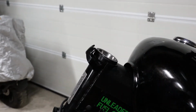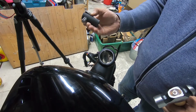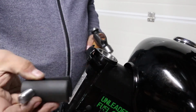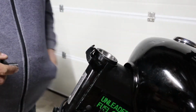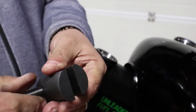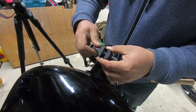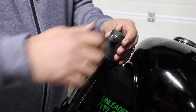Maybe I'm giving up too soon, but I also have this device, which is a Sealey part. I think various people make them. So I think you just put it in and tighten it up, and then these jaws kind of open out. I do that, so that should grip the inside of the bearing, with the understanding being that it will then just pop out. So that seems pretty tight.